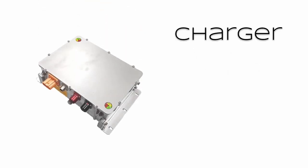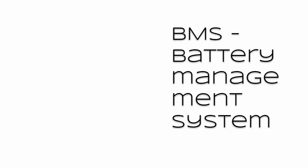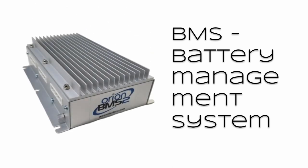A charger is a difficult question. Potentially, I may be able to use the charger from the Toyota Prius inverter, but I'm not 100% sure whether it will work or not, and I need to consider various options. Perhaps I will look at EV conversion companies that sell components. Then the BMS, or battery management system. Again, this is the kind of unknown factor for me. The very famous BMS that everyone is using is the Orion BMS, and it's sold in the UK by Zero EV. This is something else I will have to look into.